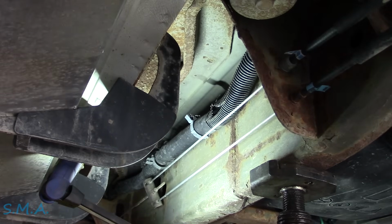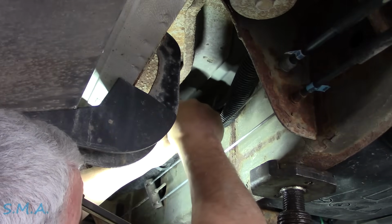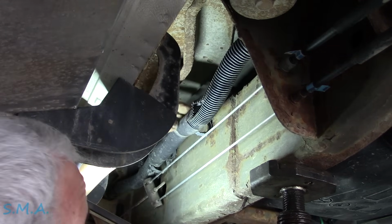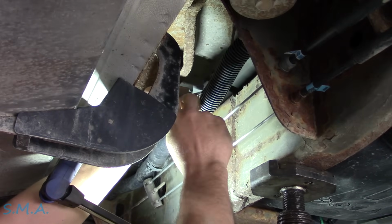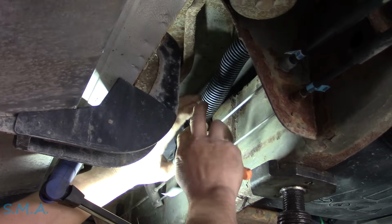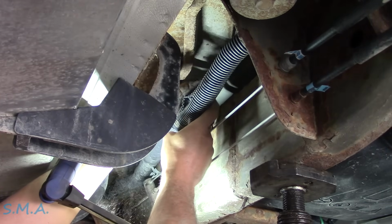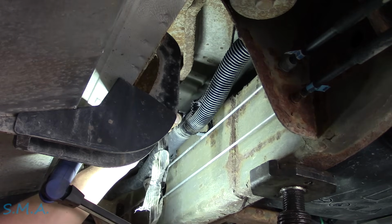Let me go get a tool here. And then saying, wow, this will be awesome, this will be fun. And then I remember trying it and using it, only to discover that the entire wiring harness turns into an antenna, virtually making the tool worthless, unless you can keep the tool a certain amount of inches away from the harness exactly, so you can regulate the type of signal that it's picking up. And basically it was just ridiculous to use in the end. It just didn't really pan out in an automotive type setting.